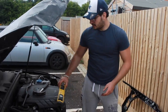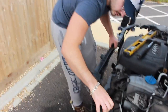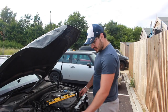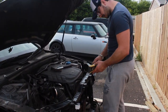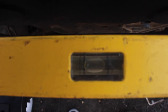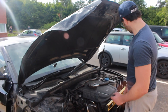So we've got a leveller here to line it up and make sure that it's level and across. I'm just going to get the slam panel and put it on there now. It's not too bad. It seems to be fitting on each side pretty well. I'm going to get the leveller to put it across the slam panel and see what sort of level we're getting. That's almost spot on — that's pretty well levelled. I think now we'll just have to put everything else on and make sure it fits properly. When we get that new wing, we're going to have to offer that up to this side and make sure it all fits together nicely and is flush.